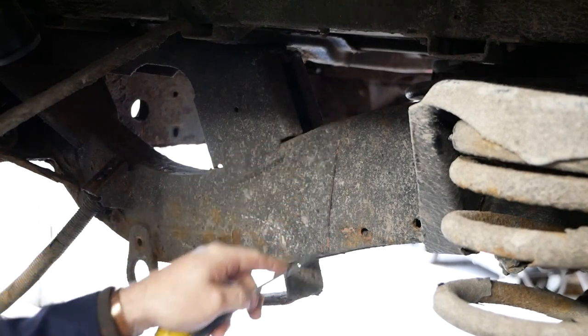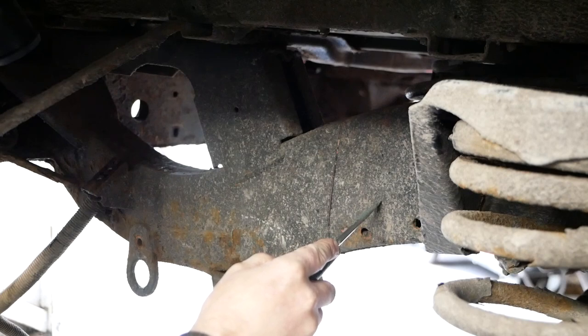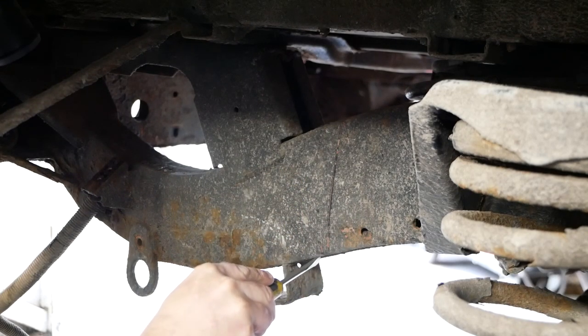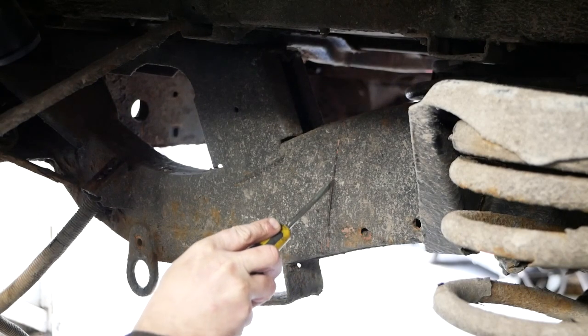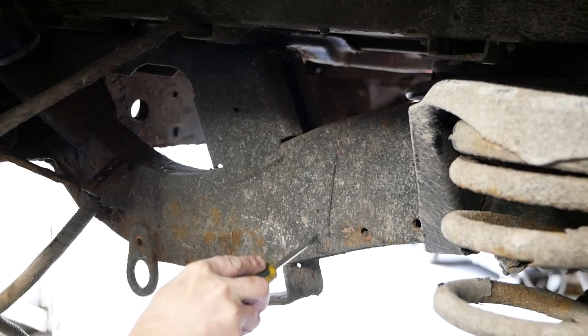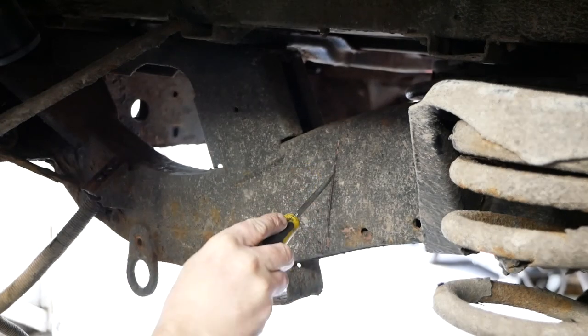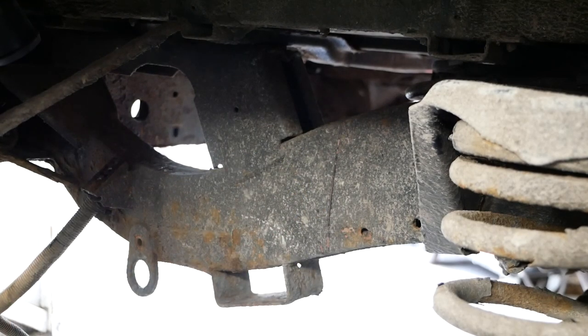So that's going to be the cut. Like I said, we've still got another sort of 75 mil to play with. If that is too short, and that one's come across a little bit, so it's a little bit more, but that's fine. We'll cut down there, and take those measurements over to the other side as well. If that's still a bit long, we can always take a bit more off. We're going to have to test fit it a couple of times to make sure it fits.